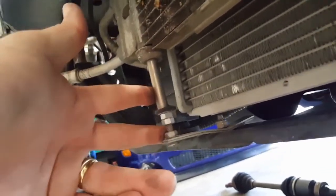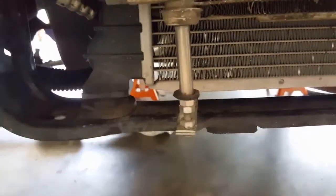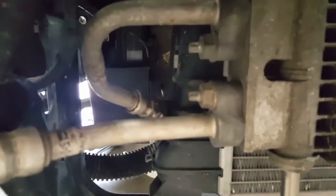This is kind of a simple thing — I have maybe $10 in parts here from the hardware store, and just getting it lined up is a little bit of a challenge. This one over here is angled more to the side while this one right here is angled more straight on. That's one of the reasons why the top of the condenser on the passenger side is sticking out a little bit and on the driver's side it's pulled back a little bit, but none of that can be seen when everything is put into place. The AC lines coming off of it are really tight through here going all the way around, but with the conversion you can still make those lines work — I just put a little bit of hose around certain areas to make sure they don't rub through and cause any leaks.